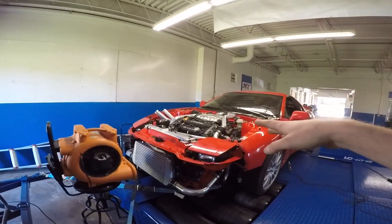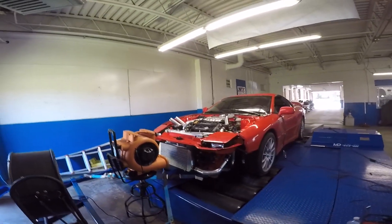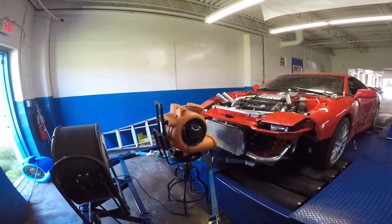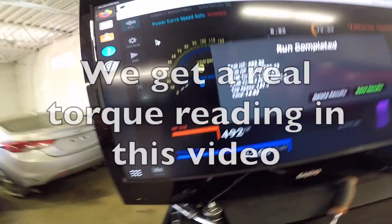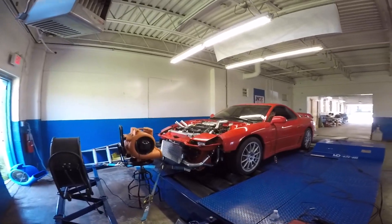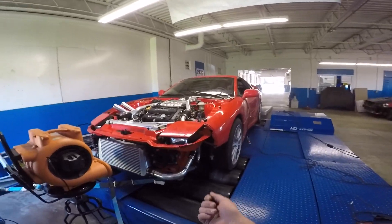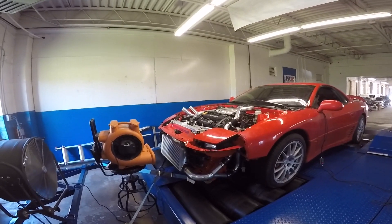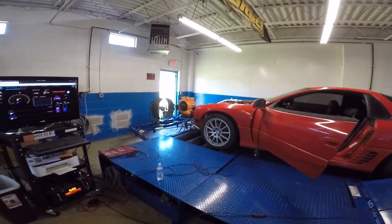I think a lot of it is those spacers, because that top intake manifold - you can touch it now. What was my intake temp? 89 degrees - that's 80 degrees less than what it was last time with the two side mounts. The torque is still all over the place because the tach signal isn't picking up. We've tried every plug. I might just stick with it - just kidding, relax. We're going to do one more pull on 93 to see if we can actually hit 500, then definitely do a 110 map today.